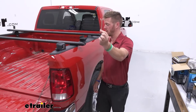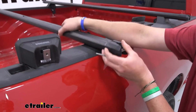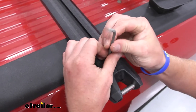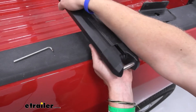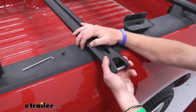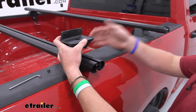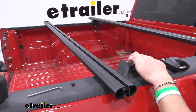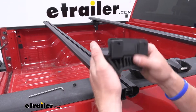We'll take a little Allen key right here and take this bar off. This is the bottom end of the bar. The top end's going to have this little strip in here, so you flip it over — right here is what we want. We're going to loosen this up. It's kind of hard to fish it out with your fingers because the track's so low, so I rotate it like this. You want to keep that in a safe place and take this off. We only have to do this on one side. We're on the passenger side, and when we flip this bar over, we want this ridge to be like this.